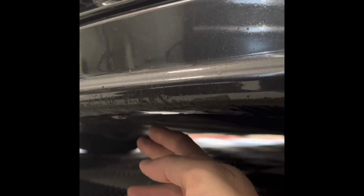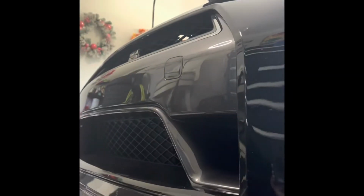And then when you have the car jacked up, oh yeah, you're not gonna be able to see that. But when you jack the car up, look at all the scratches where it's hit the bottom. There's all these little rubber plugs right here, and clips, and a couple of screws. When you take those plugs out, there's bolts up in there. I think I only took 4 of them off. The instructions say to take all these different bolts off, but you don't actually have to do all that. I just took enough off to disconnect this under tray from the rest of the under tray, and I left it attached to the bumper, and then I pulled the whole bumper, just popped it off.